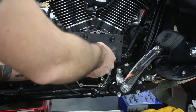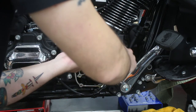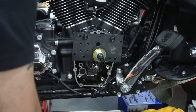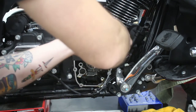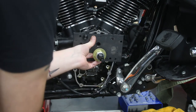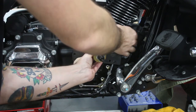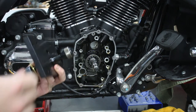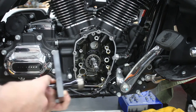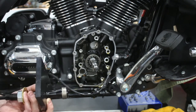Before taking any of this apart, I'm just going to take the whole thing off as an assembly - take our thumb screws out. There you have it - there's your old bearing sitting on the mandrel. We'll disconnect all of this and the bearing will come off easily. We'll proceed from here to installing the new one.